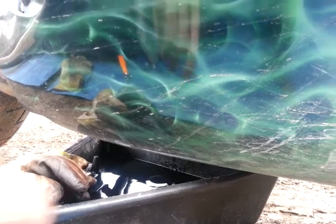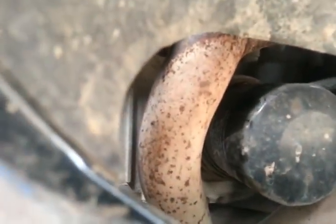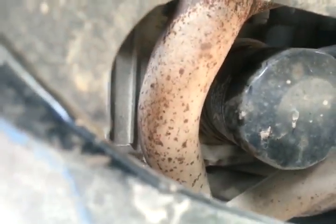This is my first oil change on this bike, though not my first time ever changing oil. At least you can do it without taking the fairing off — just be mindful that it doesn't splash like it did. I changed the oil and the filter. Right in there is their filter, and I got a filter wrench to get in there. You don't have to remove the fairing to do it, which is nice.